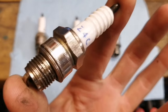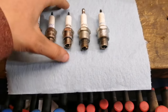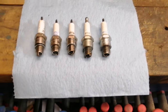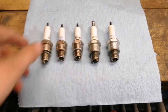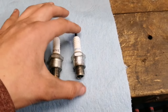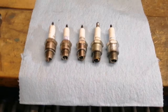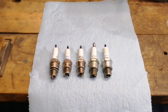These stock kit plugs do the job and have removable caps, so they're somewhat quality. But there are better alternatives: the NGK B7HS and the BR6HS are both great starting points. I say 'starting point' because spark plugs are all different — whether you're running a 212cc or a motorized bicycle engine, every engine is different and there's no set plug for a set engine. It depends on your exhaust upgrade, airflow, heat ranges, and so on.